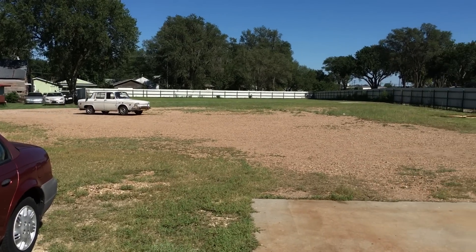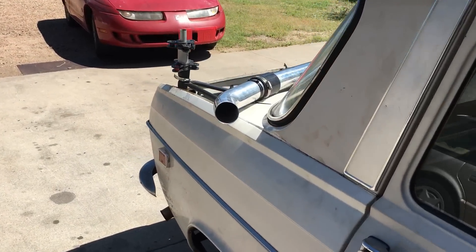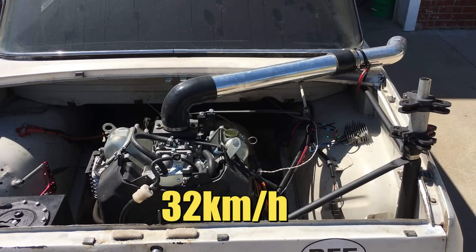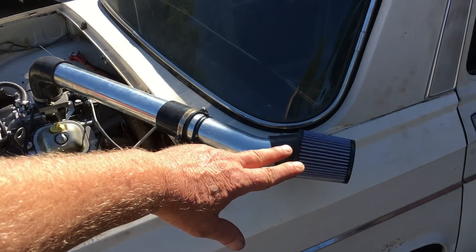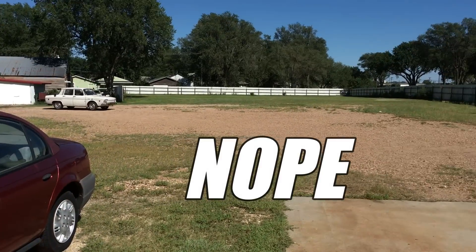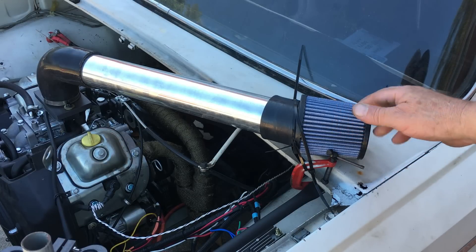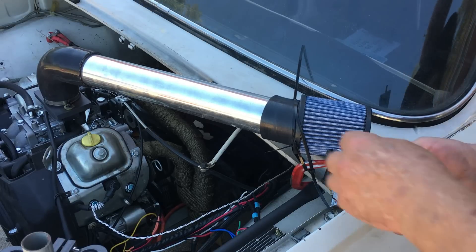We didn't even get a chance to get the cameras rolling. This RAM air is very effective, and without the air filter we see the effects kick in at about 15 miles per hour — and they ain't good. Apparently, we are forcing too much air into the carburetor. According to the wideband air-fuel meter, the mixture starts going lean at 15 miles an hour, and by the time we hit 20, the air-fuel ratio is approaching 18 to 1. This little air-cooled engine can't handle that. Let's try it again, but this time we'll use an air filter. This time we got the car up to 30 miles per hour before the air-fuel ratio went off the chart. Let's try one more time — nope, it just ain't going to work.